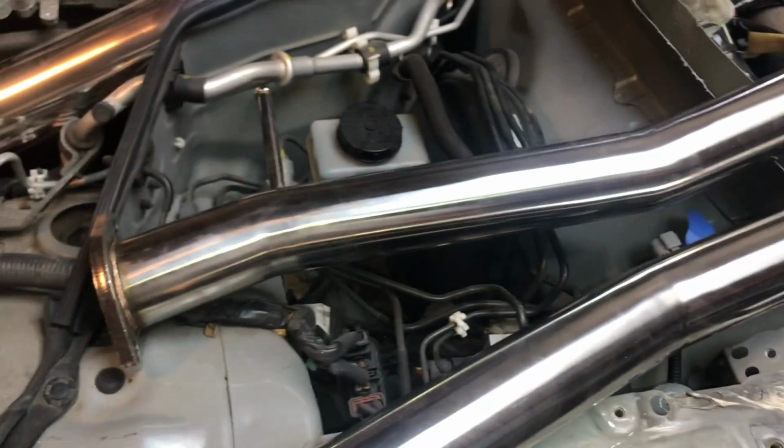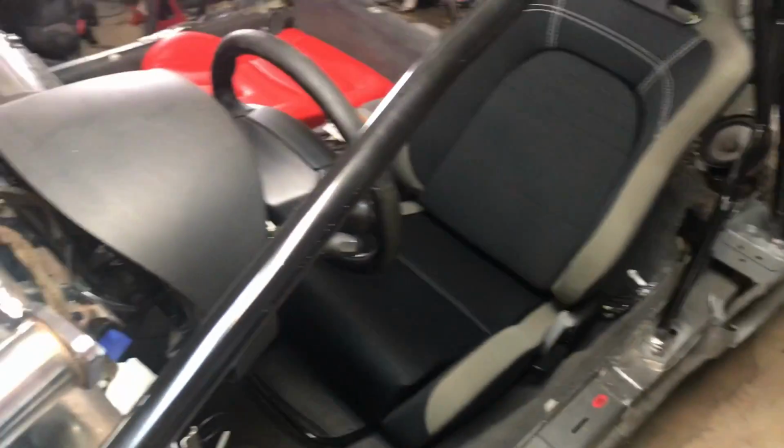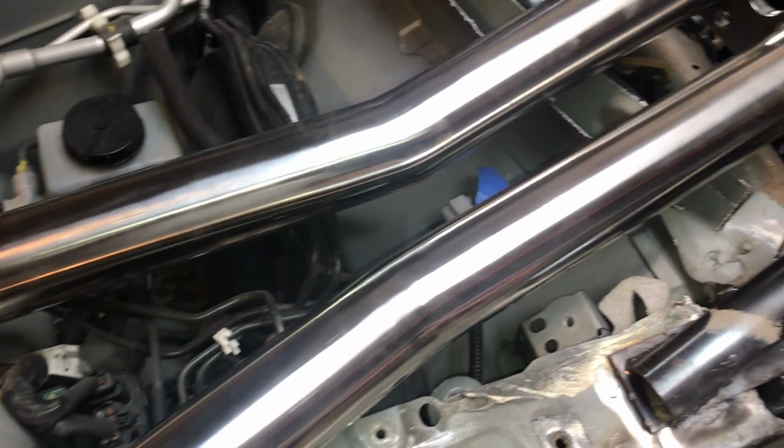And the mufflers are what have the issues in these cheaper exhausts. They're pretty cheaply put together and they don't last very long, but the pipes are, as I said, pretty good quality. So I don't plan to keep the mufflers that came on it. I really like the sound of the straight pipe. It is a little loud, so what I'm planning to do is put some resonators in where the mufflers are, and then use the rest of this piping from eBay because it's basically all I need. I don't want to buy an expensive system just to chop it and mess with that, because if I bought a $2,000 exhaust and then cut into it, it's really not worth it. So that's what I'm doing for the exhaust.